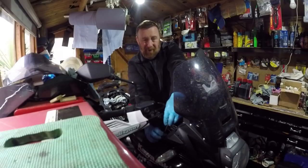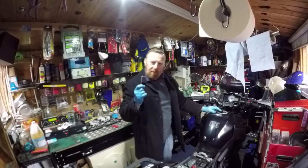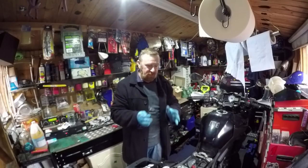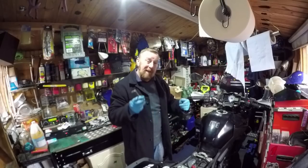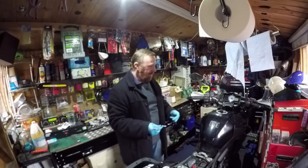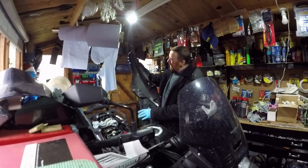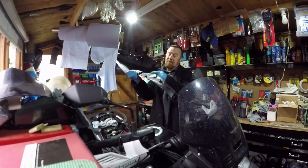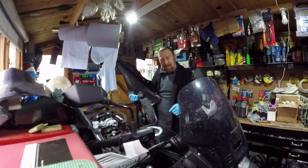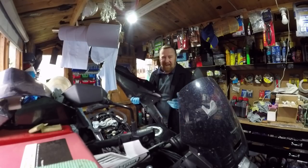Don't be afraid to take panels off — just make sure you know where all the nuts and bolts are. Actually, be more afraid of where you put them when you've taken them off. Have a safe place for all your nuts, bolts, and tools. Also try to keep left and right separate, because sometimes the way they're threaded can differ. My only tip about these plastic clips is they do snap in the cold. Give them a wiggle, and if it's freezing, use an old hairdryer or heat gun to warm the area first. It'll stop you snapping them.